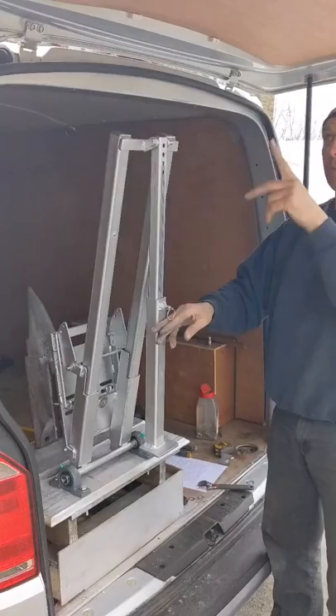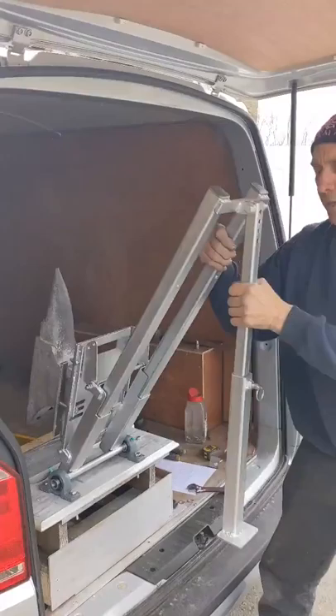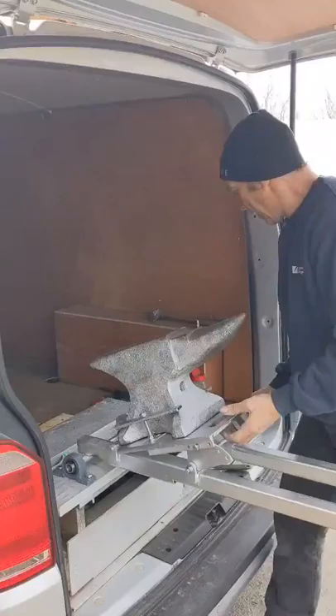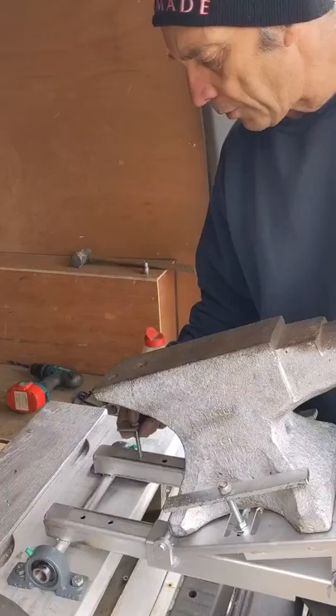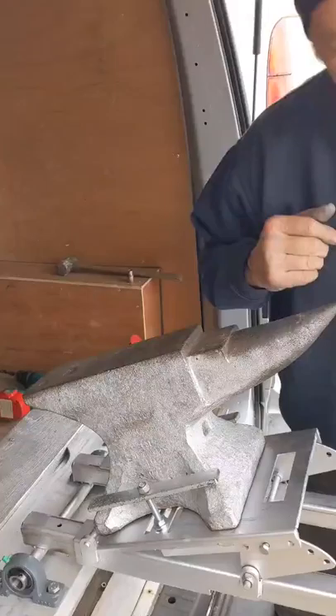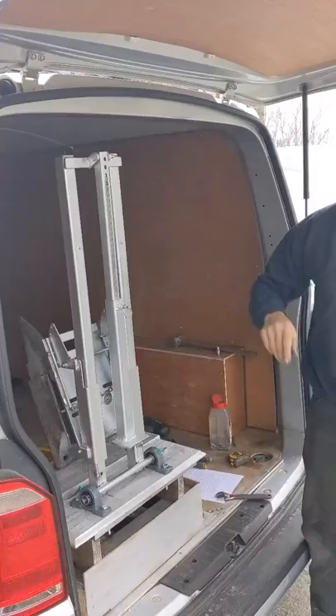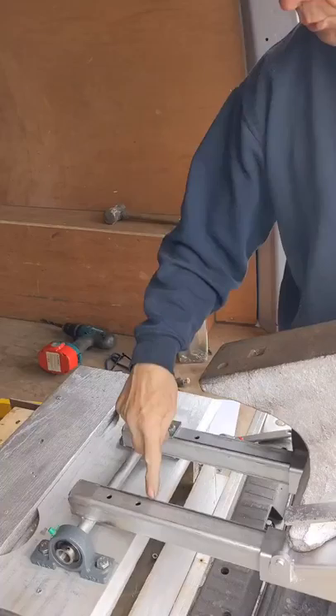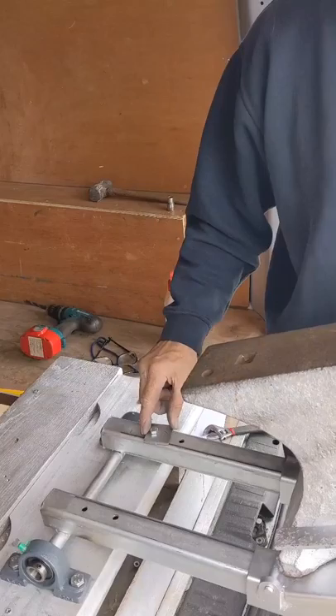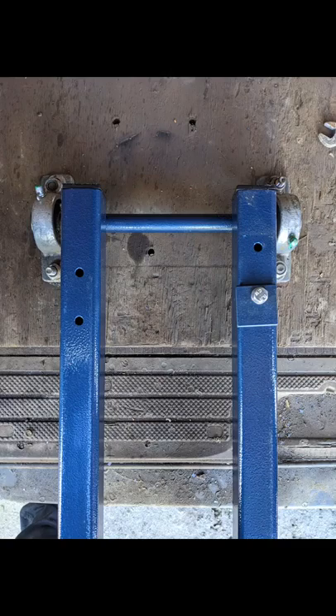The tailgate won't close, so we have to adjust where the anvil stops. Bring it back out a little, put the little square stop plate into one of the four holes drilled in the track — a bit of trial and error will find the right position. Now when you stand it up the track is vertical inside the door. The plate gives four different adjustments per hole, and there are four holes, so turning it 90 degrees each time gives you 16 adjustments in total.